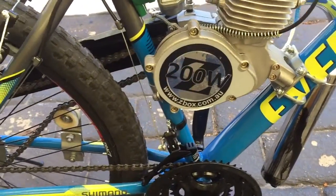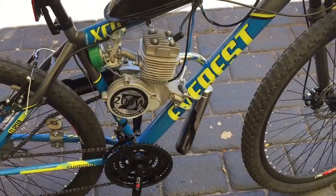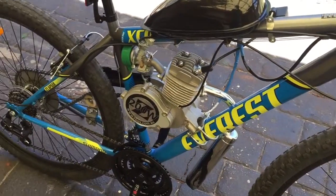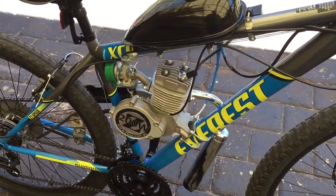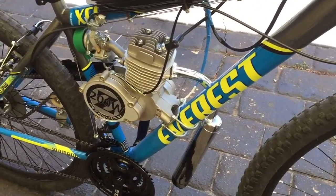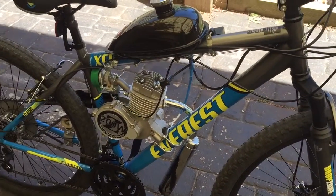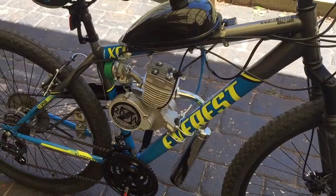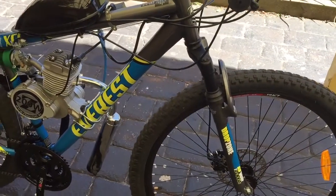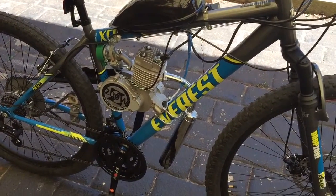So far it has been easy to start. In the stop position you just have to flip the pedal - you probably need a little bit of muscle power because you've got to lift the back wheel off the ground. If you don't have the physical strength to lift the bike up and flick the pedal, you may just need to ride it. Once you're riding at a reasonable pace, just drop the clutch and it will fire up - you can do it that way.